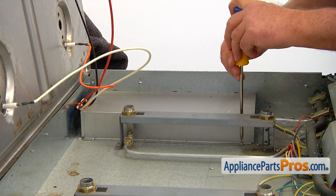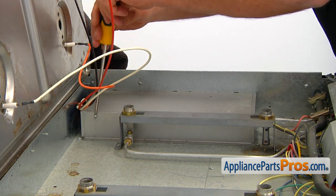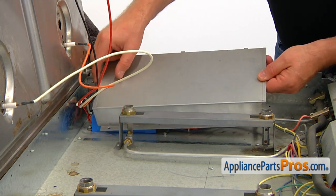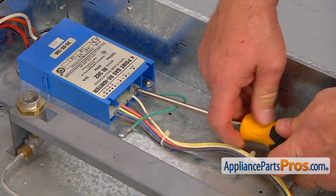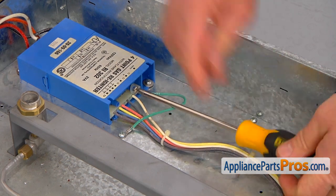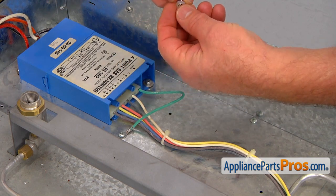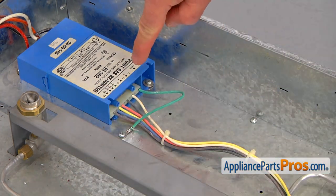Next, we're going to take out the couple of Phillips screws that hold the cover, and now we can lift up the cover. Now we need to remove this single Phillips screw that is securing the plug — don't forget about the plastic washer, we're going to reuse it. And now we're going to pull the plug.